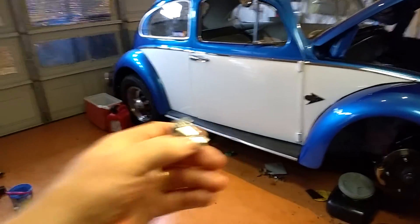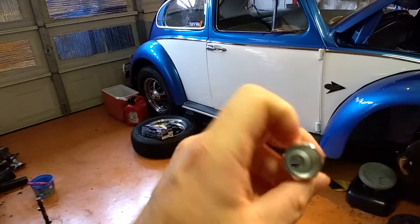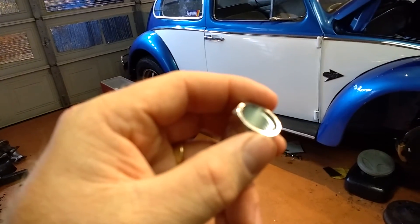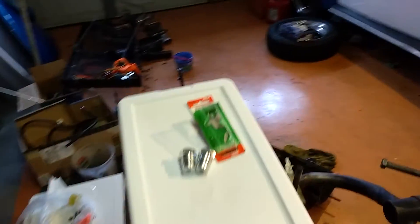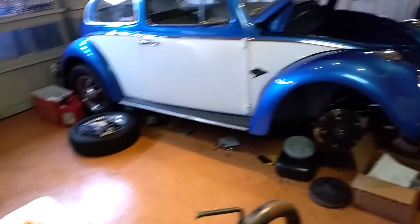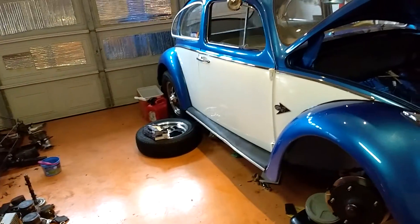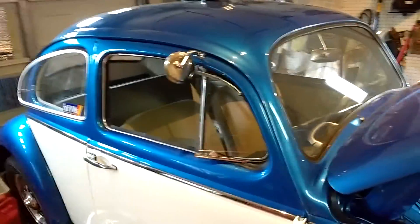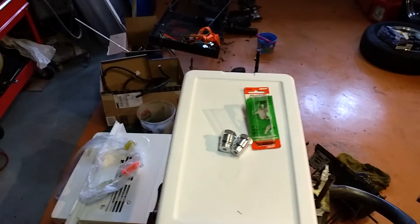Run down to the auto parts store, get a spark plug no-fouler, cut it below the hex head. Each O2 sensor is probably going to be a little different, so make sure it's the right size. If you look, they've got a little bit of a taper for the gasket, so everything should work good. I figured I'd give you all a little helpful tip — hopefully everybody's having a good time working on their cars. Keep these things running; they're getting fewer and far between no matter what you got. Subscribe if you like the content, hit the like button, leave a comment and I'll try to get back to you. Let's get these things all running — Chevrolet, Volkswagen, Toyota, or Honda. See y'all later.